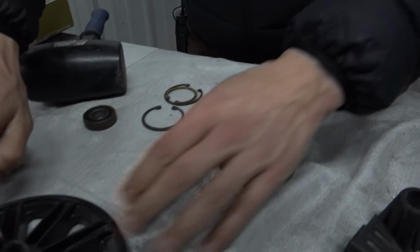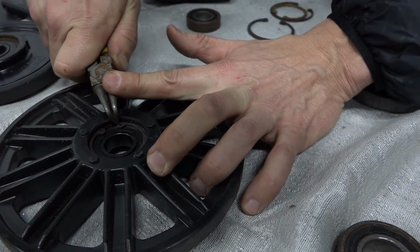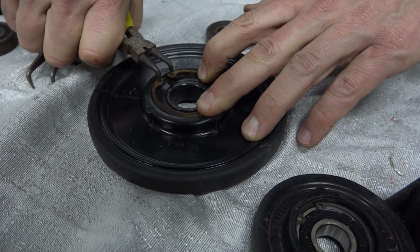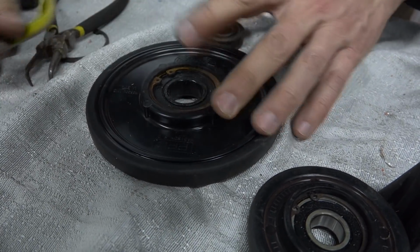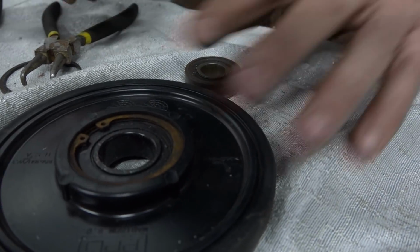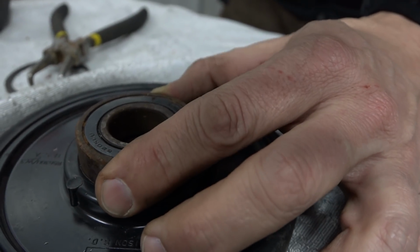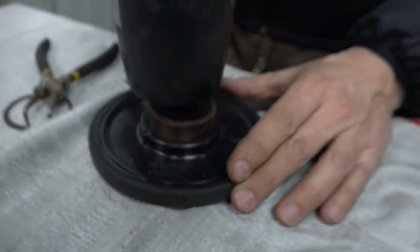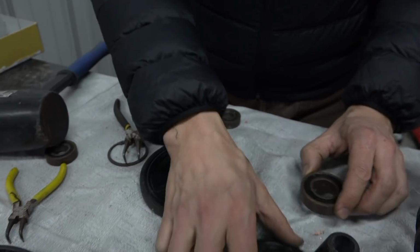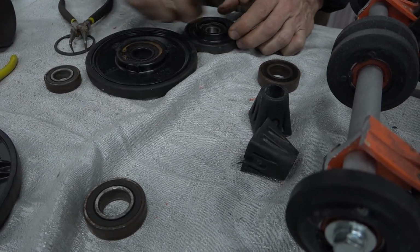I think this one goes in the small guy. Make sure when you're putting these in, you hear your little click. So I have my fingers on there holding that just for that reason. Now, is this the right one? Yes, I think so. And sometimes, if you're not quite sure, you can just put your old bearing on top. See, there's still a little bit of play. It's not going to get jammed in there. Just do one of these. Watch out there, Simon. That'll usually sort of find the happy place. A little too big, this one.